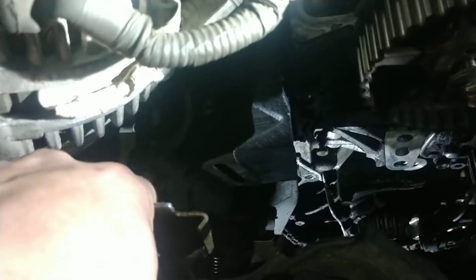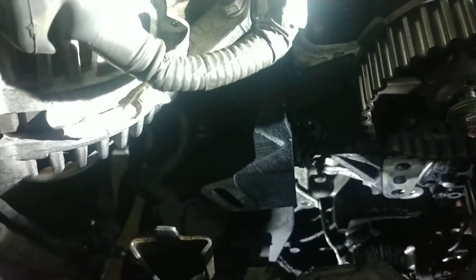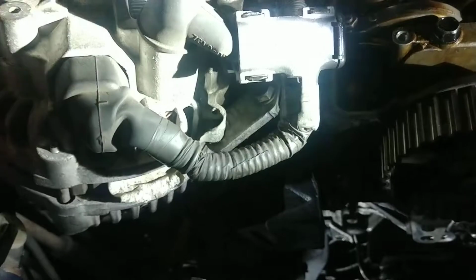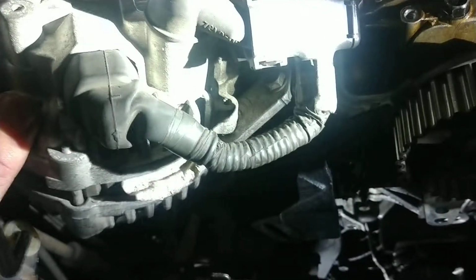You need to take out the alternator. If you don't know how to take out the alternator, it's pretty straightforward. There's a large bolt on the top that goes through this hole. It is a 14mm bolt. It holds it in place up here at the top. As well on the bottom, this one has a wing nut attachment down towards its bottom side. You need to undo that so you can loosen the holding bolt that holds that wing nut. It's a 12mm. Once you get all three of those undone, specifically take out the lower bolt, and the upper bolt is long enough that it can't slide out. It pushes against this, but it's enough to get the alternator to lift up and out. I haven't attached it. I didn't see any need to. So I just have it sitting there unbolted.